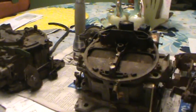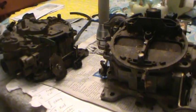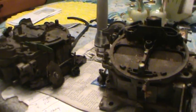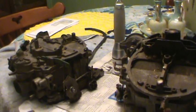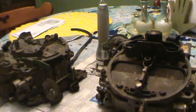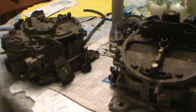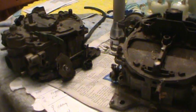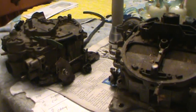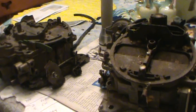There's been a lot of conjecture and guesses and estimations of how much CFM a Quadrajet flows, but I'm going to tell you the direct truth on this based on fact. There's only two: there's a 750 and there's an 800. There were no 625s, no 650s, no 675s, no 725s, no 700s, no 825s, no 850s. From the factory, there was only two. So if you hear somebody say otherwise, they're just guessing at it.